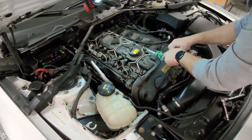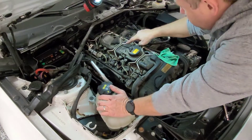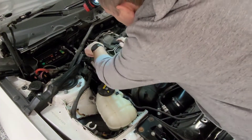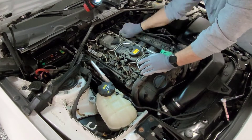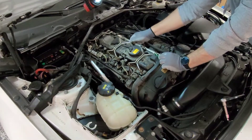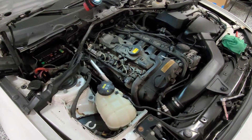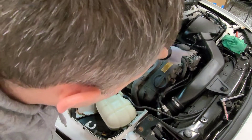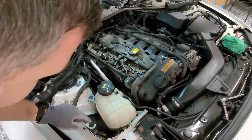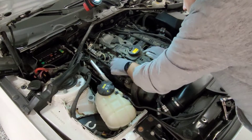Keep a rag right here to soak everything up. Now we're going to undo all these bolts so we can move the fuel rail — there are bolts in the back holding it in place. To get the valve cover off you'll also have to undo this bracket right here — those are your oil lines that run from here into the oil radiator sitting underneath. This wiring harness needs to be unscrewed; you have to undo all the fasteners unfortunately in order to get to this.